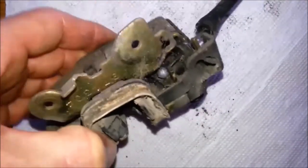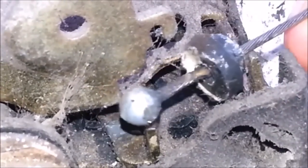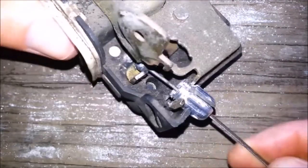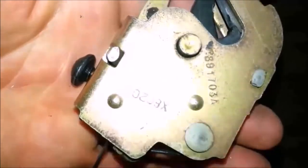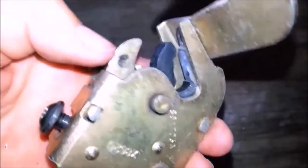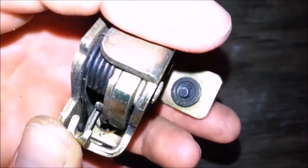You don't have to remove the cable from the latch, but it'll probably be easier to work on if you do. On some latches it's pretty easy to remove the cable — you just lift it straight out, and reinstalling it is just as easy; just snap it back in place. On another type of latch, the latch releases pretty quickly but the cable can be pulled all the way to the edge of the latch, so cut the adjuster pretty short. The latch release might hit the adjuster, but it shouldn't stop the latch from working.